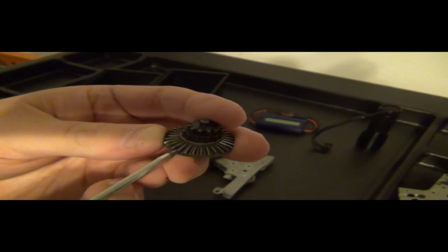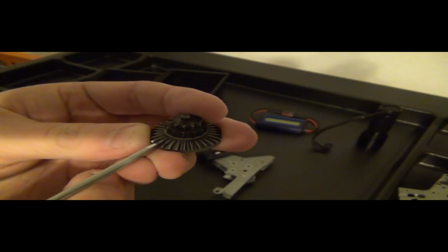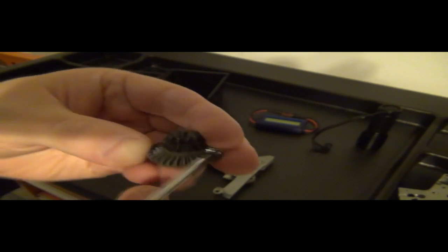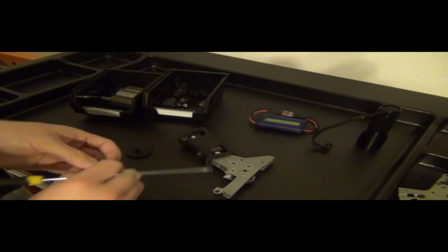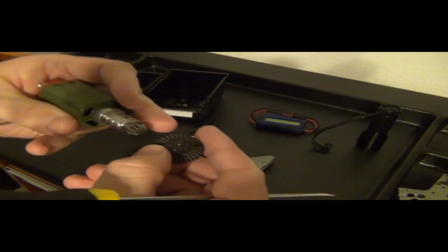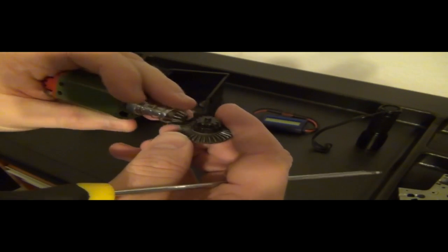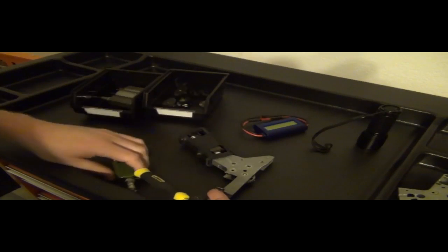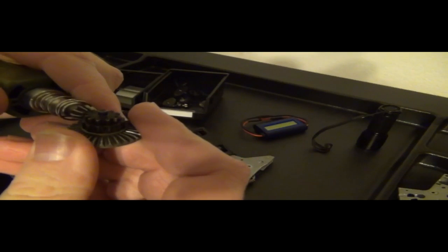If you go to check it when it's a little bit this way and the gear is between here and here with 2 teeth, then you can't tell until you start to rotate. Okay, it kind of sounds like, what the heck are you talking about? But it really is true, because as this spins, if it is just a tad bit too close, it will press down into the gear. And even though this will work very well, it'll work fine, this thing will tell me that, hey, there's a little bit of pressure, you're a tad bit too close. So you have to be a tad bit further away.